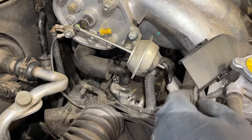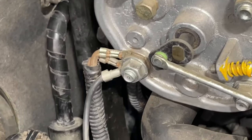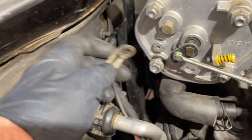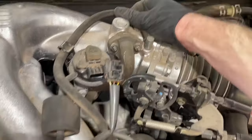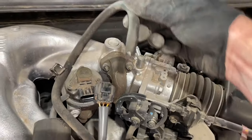There's a little vacuum hose here that we're going to pop off so we won't have to remove too much. Then there's two grounds here — we're going to take a 12mm socket and take this nut off. We're going to remove the two grounds out of the way and just put the nut back on. Next we're going to go after our EGR here, so we're just going to unplug it and then pull off the vacuum tube on the back as well.